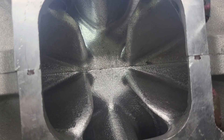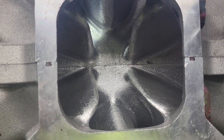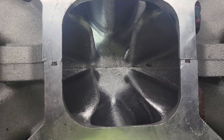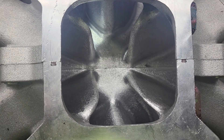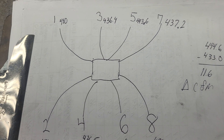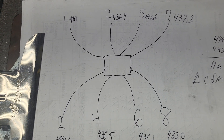When I bolt this directly to the bench while it was still wet after washing, with all eight runners open, you could see how much the center four blow out. With all runners open the bench could only produce two inches of water — it cannot flow that much air. But it's interesting to see by putting your hand at the opening where the flow wants to go: it wants to flow through the center ones. Looking at our sheet, our only real low outer runner is number 8. Everything else is pretty good on the outer four, and the inner four are quite even.